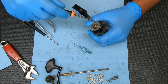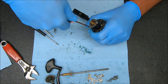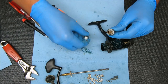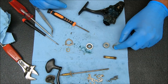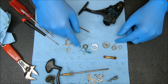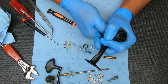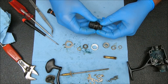Now we do the pinion stack. Notice at the top of this pinion stack there's a washer, and there's also a bushing inside the pinion gear. Just remove those three screws so you can get that bearing cover off and pop that out. There's a washer on top and here's how the stack looks: you have a washer on the bottom, the bearing, the entire reverse clutch, a cup with the bearing inside of it — the sides are different — and then a washer on top with the cover going over it.